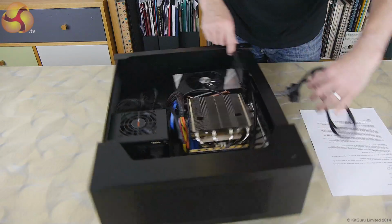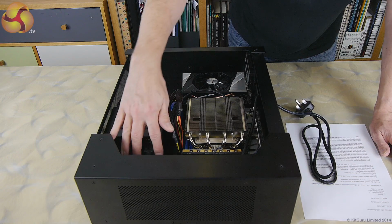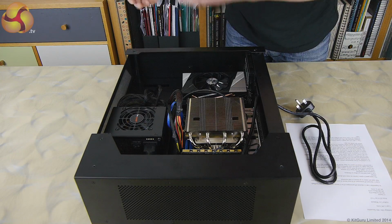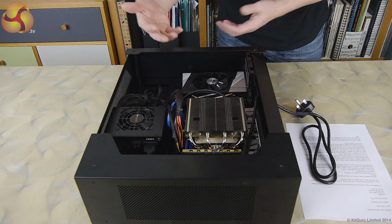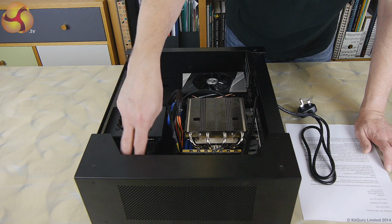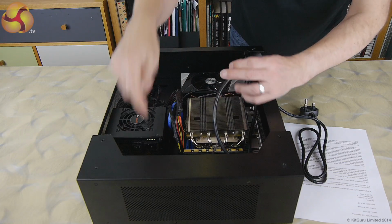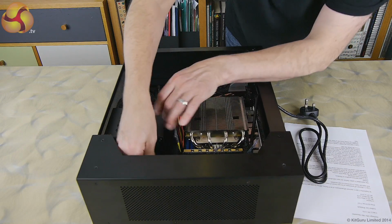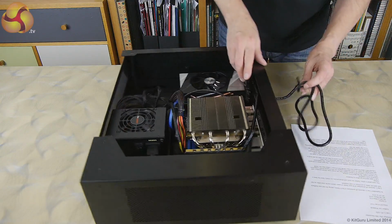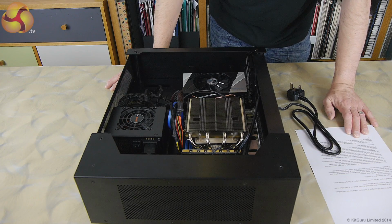Now then, if we turn around, so you can see where the power supply connects. This is another oddball feature of this case. The four screws that mount the power supply on this bracket here, they're obviously inside the case. Every power supply I've mounted in my life, I think, in a case, it screws to the outside. You have to sometimes slide the power supply through the case or slip it in through the side or some such, but the screws are on the outside of the case. Here they're inside. And this is really peculiar because it means that the mains socket, as it is, no, mains plug, isn't it? That's right, it's the female that's on the cable. So, socket, plug. It means that you have to feed your mains cable through the PC and out here. And to do that, through this sort of little opening here, you actually have to remove this panel, which is held in place with three screws. And that very much gets to the heart of the PC-O5S and its design.